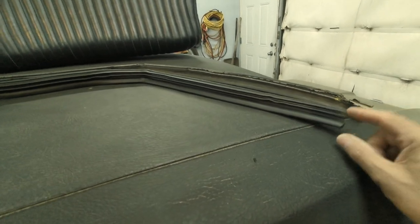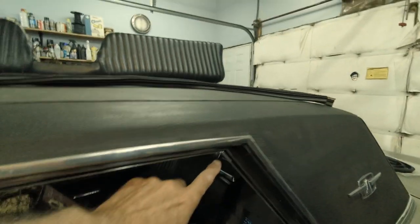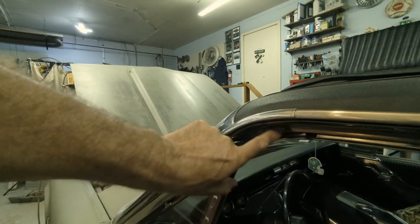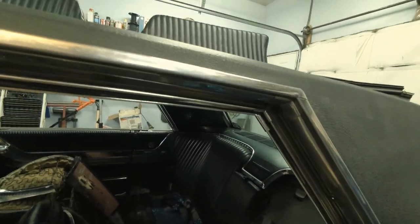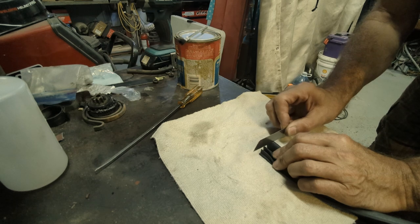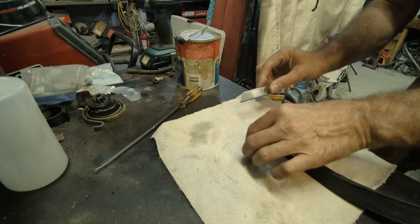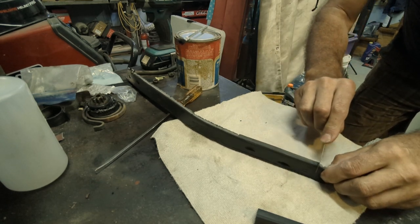What I'm going to do is trim this off right flush square. Then I'm going to go up here because there's a section up here that's soft and in really nice shape still — hasn't been torn up or anything. So I'm going to cut this section out here and glue it with contact cement on the end and put it in. The gasket comes to about there, so it'll just be that little bit left going down in, and it'll be perfectly fine. I think they cut both sides. Not the end of the world — you work with what you have. So I'm going to trim this off square. I'll lay it flat and trim a little bit off — this is a brand new knife blade. Just get it trimmed off, just like so. Good and flush. Now I'll cut the donor piece — this is a really nice section right here — and I'm just going to cut it off flush as well.